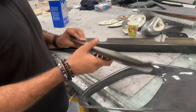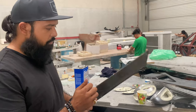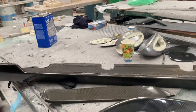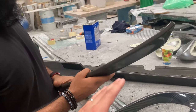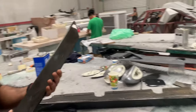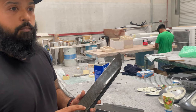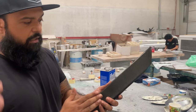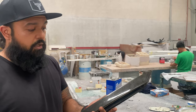Here with Karen from Kush Carbon. He's going to sort out my carbon fibre - we're going to duplicate this part for the other side, which is missing off the car, and we're going to fix up this side skirt which is also cracked. So how are you going to mold this, how are you going to make a copy of it? Basically we're going to make the part out of foam, duplicate it, make a mirror part of it, pull a mold off that - that's called a plug - and then we'll laminate the carbon on.